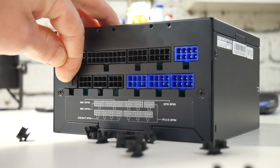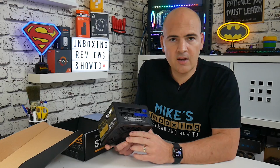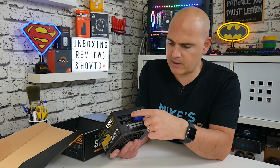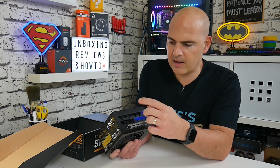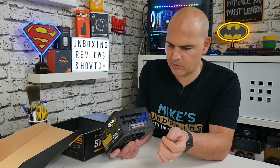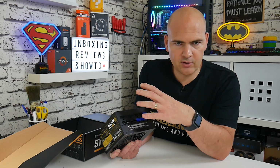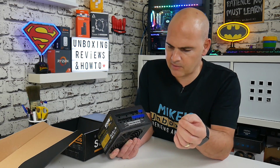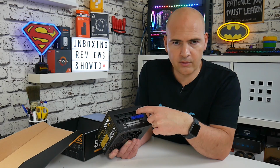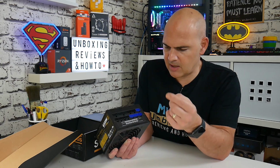I'll go ahead and take these all off a second. So let's run through the connectors. These two at the top here are for the main motherboard connection. That's a 24-pin connector, and they split it down into two sections so they can get the most stable power possible through there by using a combination of different outputs on the actual PSU itself. Over here you've got your 8-pin connector for the CPU power, EPS 8-pin.